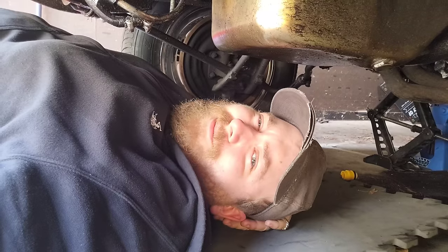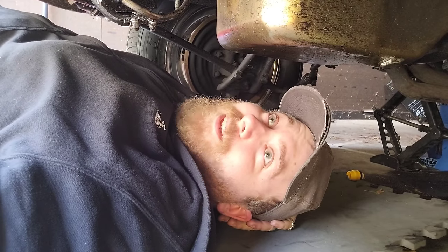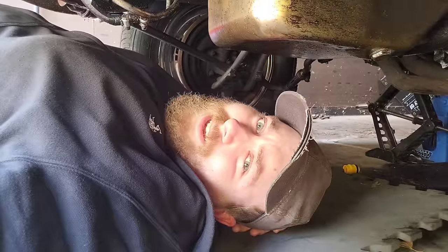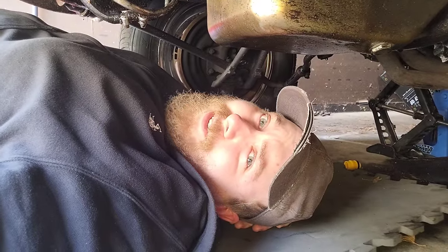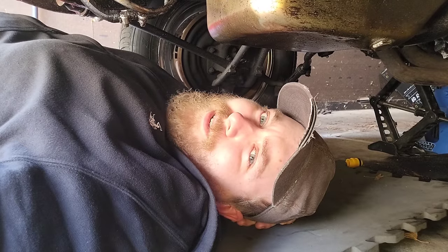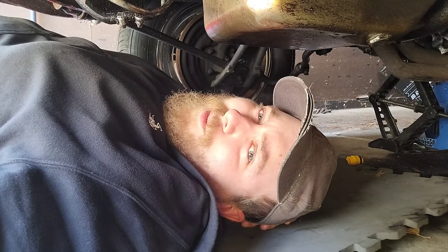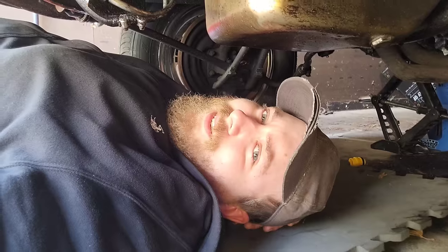Numbers matching? Nope, I didn't have a slight chance or hope of that happening. Because this used to be a drag car and somebody took the nice motor out before they sold it and put this in. The C stands for 60s. The 9 stands for the year, so it's a 69 block. The 6015 — they just stamp that on a lot of these. And the C in the back is some lot number or something. So yeah, it's a 69 block.